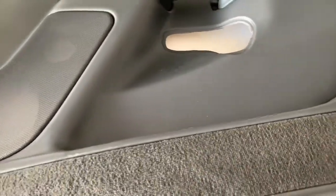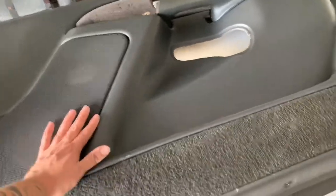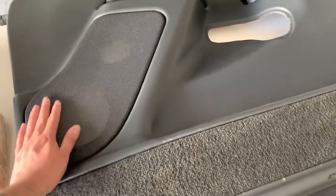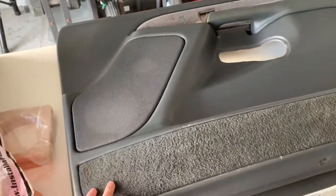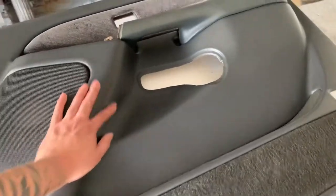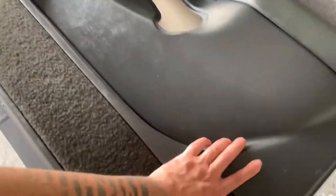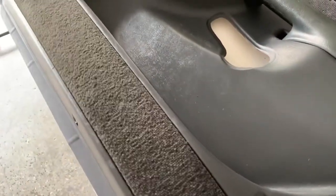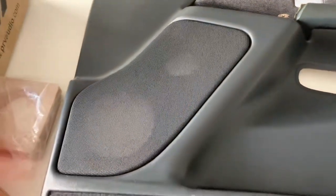Then after that, shape it to how we want it and place our rings on it, and then fleece it, then fiberglass it. He's going to get vinyl, but I'm still going to fiberglass it a little bit heavy so it's strong. I'm going to use Duraglass so it gets even stronger since it's vinyl and not paint. We don't require the top face of it to have fiberglass mat, but we still want her to be strong, because you never know, them nights you get crunk, you slam your door, you turn the music up, you throw your door open, whatever the situation is, we need it strong so they don't mess up on my boy.